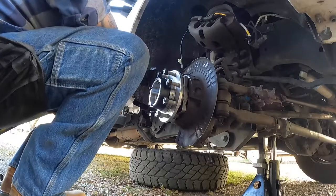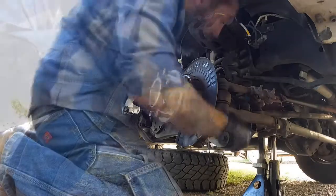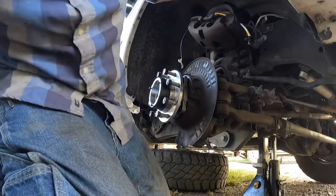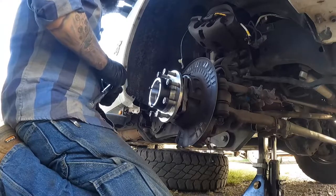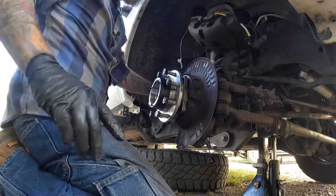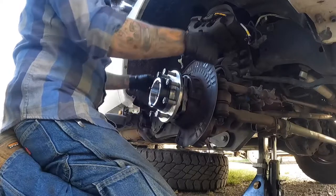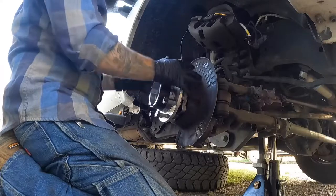And then as I tighten the nuts on the backside, this will pull in as much as it needs to. So let me go ahead and do that real quick. I'm gonna run everything down with a socket wrench until it gets snug, and then I'll torque them. And seeing that there's a gap in the flange, I actually don't wanna pull one corner in too far at once. So I'm gonna four point it crisscross until everything kinda settles in.